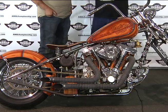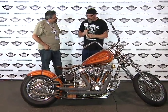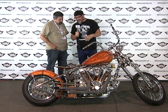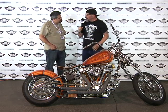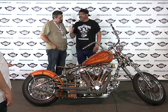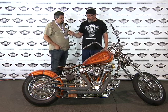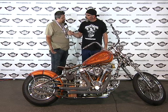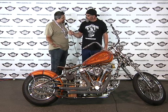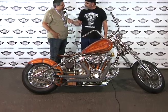When you're tuning some of these metric engines, it's a little more finicky. What did you use? You've got an S&S air cleaner on there, but in terms of the element and filters, what did you do to help that breathing? We used a K&N air filter. We also have a K&N oil filter. We rerouted the oil lines so that we can get the oil filter on the side, in Indian Larry style. We mimic his work as best we can.